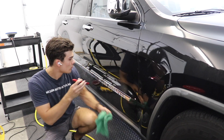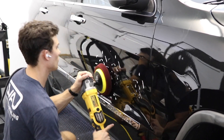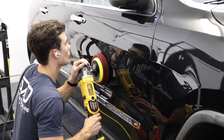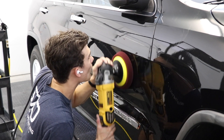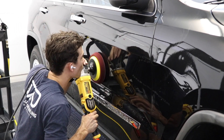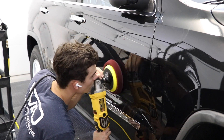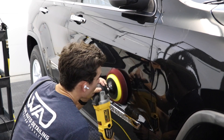Another reason why I'm pulling out the rotary here is a bit counterintuitive. Some people will say I'm using a huge pad on the rotary when I could use something smaller to get into those tiny cracks and crevices — but this is actually on purpose. It's also not necessarily true that the rotary is always faster. A lot of those myths in the detailing world persist because people keep repeating them. In this particular situation, because I'm dealing with harder paint and a lot of swirls I want to take care of pretty aggressively, the rotary made sense.